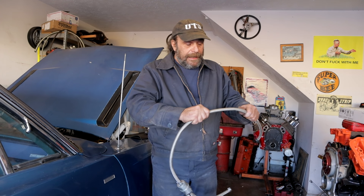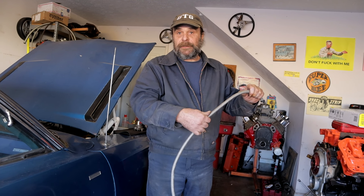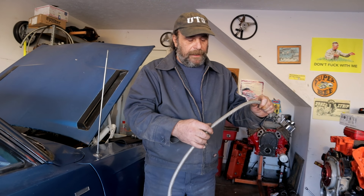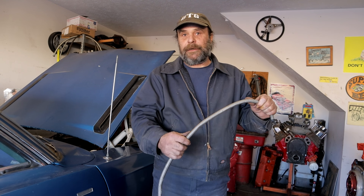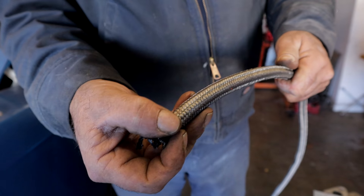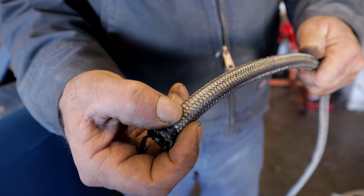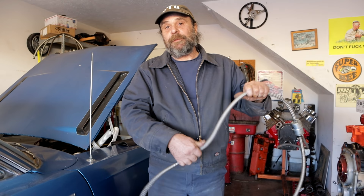I use this stuff — this is a water hose. The braided steel fuel line is rubber inside, but this has the same exact braided steel sheathing with Teflon on the inside. It's impervious to the effects of ethanol and gasoline, it will never dry out, it doesn't go bad, it stays pliable. When you fit it over a barbed surface to put a clamp on, you do have to heat it up a little bit to get the inside plastic soft.